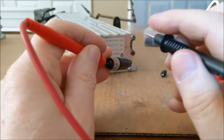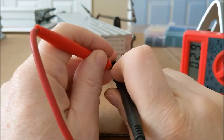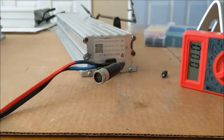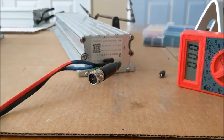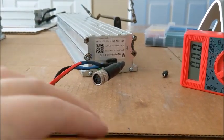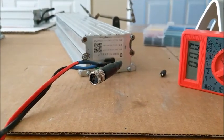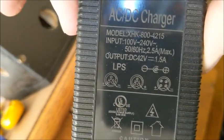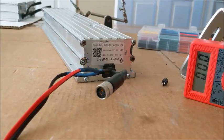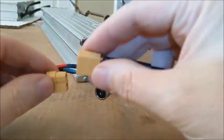You have to be careful not to touch anything. If you can see that, I'm getting 2.9 volts. JAG35 says that if you start applying a charge to this it may wake it up as well. So I've got a small 1.5 amp, 42-volt charger, and I also have a 3 amp charger — but I think I'll start with the smaller one. They say you're supposed to start with a smaller charger if you're trying to wake the batteries up or if they've been discharged too low.